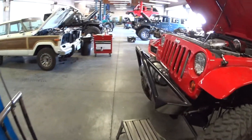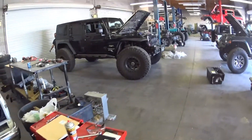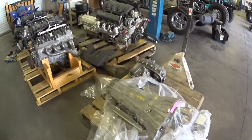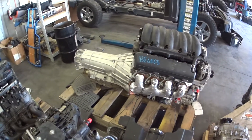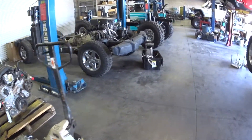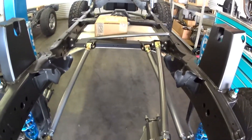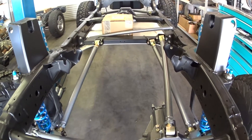We've got a couple of interesting builds going on, so I thought I'd share a few of them. This is our Gen 5 build — we'll talk about that more later. This is going to be a 6.2 LS3. This here happens to be a Gen 5 6.2 L86 with an 8-speed transmission, an 8L80, going into this chassis. This is a custom-built chassis by Curry — it's got 70s in it, long arms, a bunch of cool stuff, a lot of money in this one.